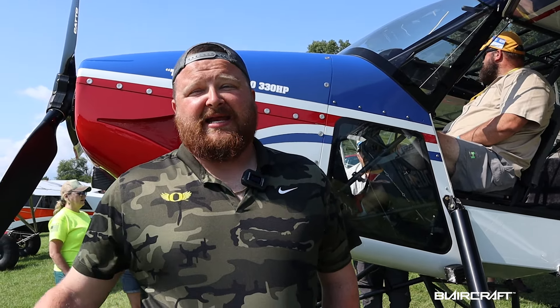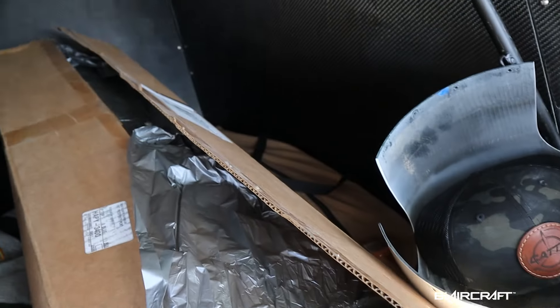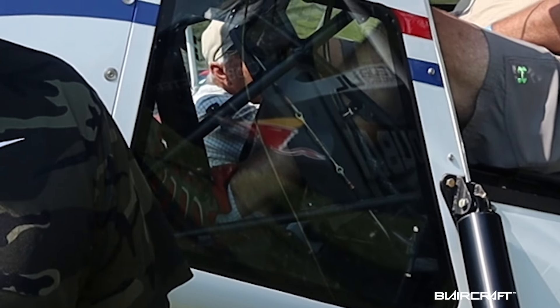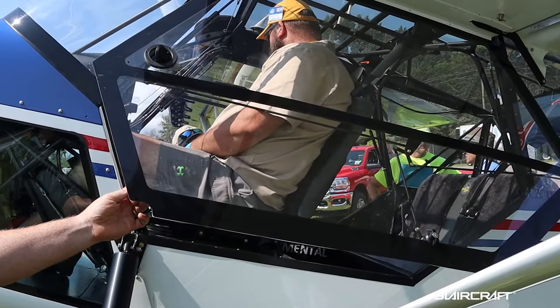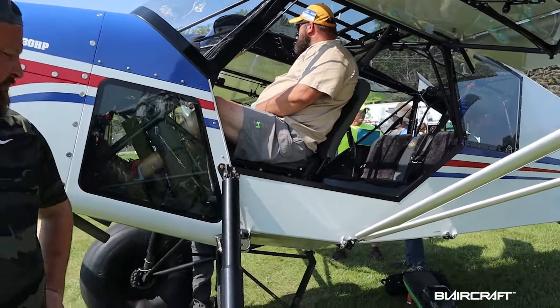Moving behind the back seat, we've got a 52-inch-wide cabin, wider than a 206, with plenty of leg room. Behind that is an impressive baggage area that goes back another six and a half to seven feet behind the rear seat back — you can lay two people side by side back there. That becomes the cargo area. A lot of times people move back seats to make room, but in this aircraft there's no reason to — the baggage area is just that big. And the skylights and the huge doors give great visibility. The doors have been switched from a screw system to an all-glue system because screws caused rattling. Gluing them on created a solid bond and all the rattling went away.